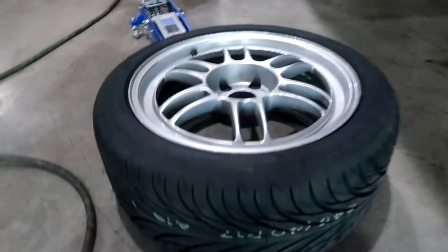We have all the tires loaded in the back and we're heading over to Long's Automotive to get them mounted. Like I said previously, I didn't think to order new tires initially because the used wheels came with tires. The NT05s are great tires, but two were pretty bald and one wasn't balanced well — it was shaking around 70 miles per hour. I brought it to Discount Tire for a balance but they couldn't do it because the tread was too low, so I went ahead and ordered new tires.